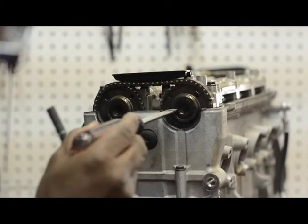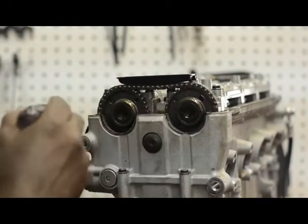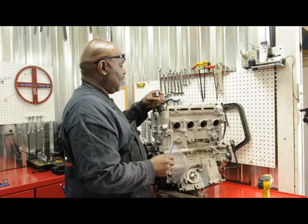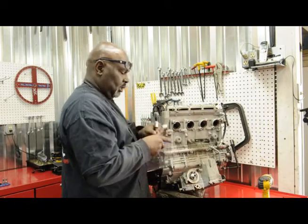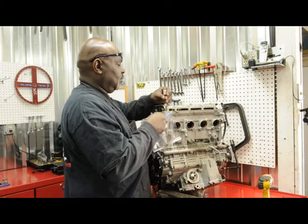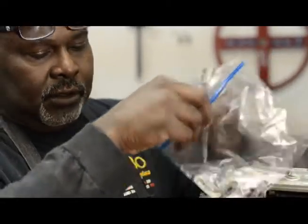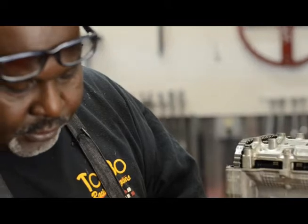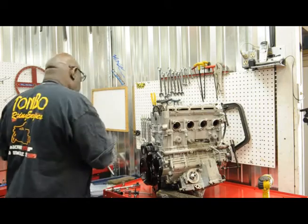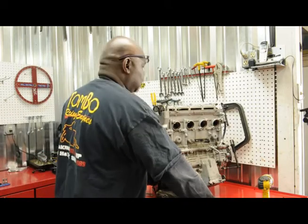You can also look right here at the little slots cut into the cams where you can see that they're perpendicular with the surface. The first thing we're doing on these cams is taking the cam chain tensioner guide off and placing it in a plastic baggie so I can keep everything together. All the components coming off this motor are going to be labeled and bagged.